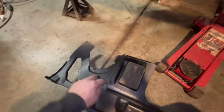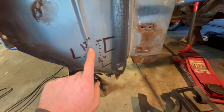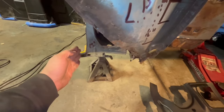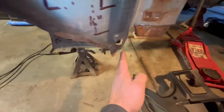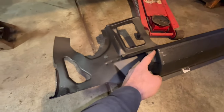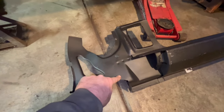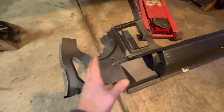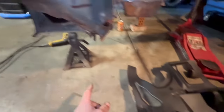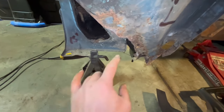I'm going to get this thing laid out to figure where we've got to cut. Let's get this thing tested into place. This is my scratch pad — that says 15. My hieroglyphics, basically saying from this leading edge to the front edge of the rocker panel is right on the money at 15 inches. So from here to here is 15 inches. We're going to cut this thing somewhere in the middle approximately, and make sure we cut the right amount off. I've measured from here back to where I cut this panel off — it's about seven inches.